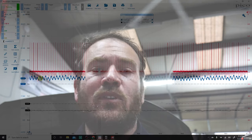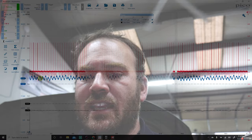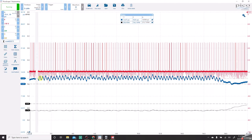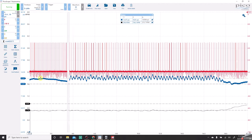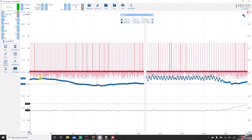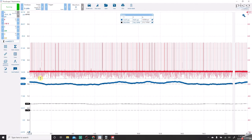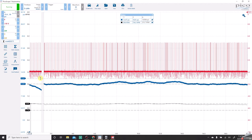I think if this thing was actually idling stable, even with a fresh oil change since it is due for service, our oil pressure is going to be very close to spec after plugging off that vacuum leak. The RPMs are going to increase until it stabilizes, but it is building more and more vacuum. We can see that on the screen as the pressure drops down and then kind of stabilizes. If I plug that little port on the vacuum regulator I'll build even more vacuum in the crankcase — I'm about 10 inches right now and I don't want to blow the seals out.